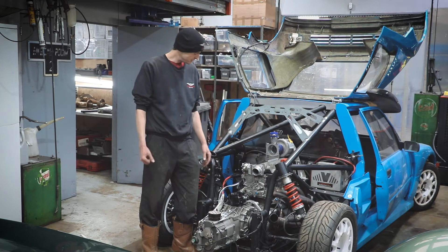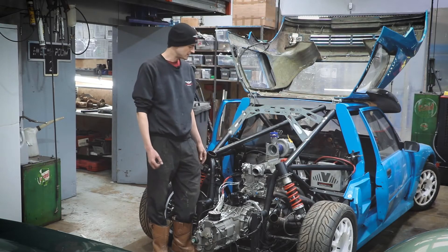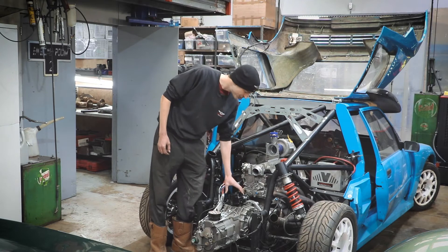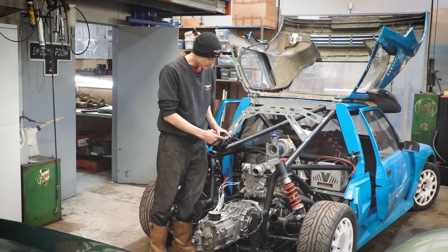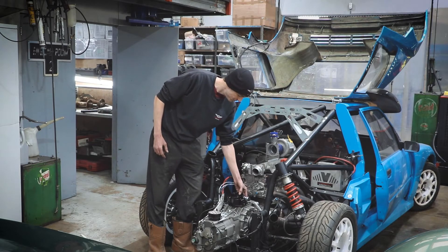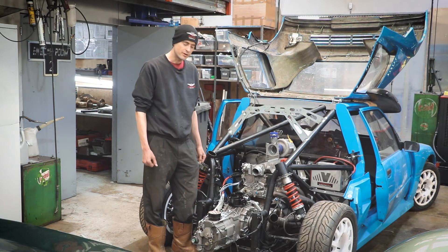Today I will be on the wiring — you can see a lot of exposed wires here. Because of the supercharger we've had to change a number of sensors, including the manifold absolute pressure sensor. The throttle body itself has two sensors: a throttle position sensor which needs a new terminal because this is new, and an idle control valve which we need terminals for as well. So I'm changing a few of those ends so that they connect to the new components, and I've also changed the routing of the wiring.